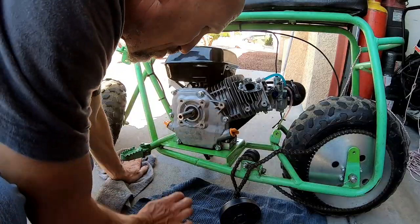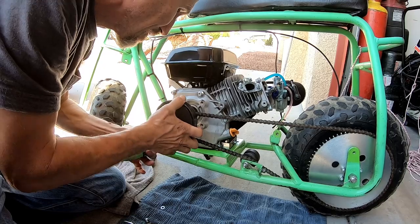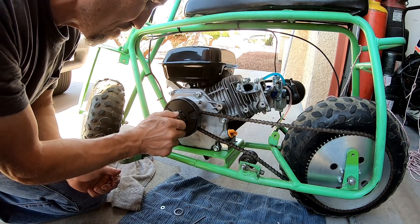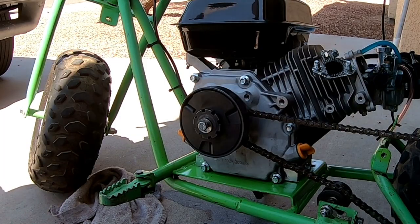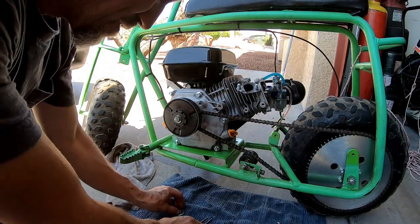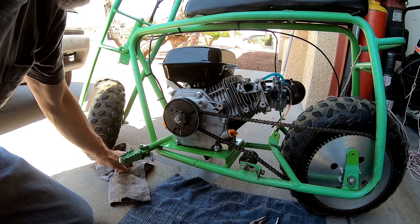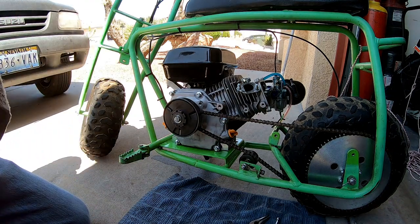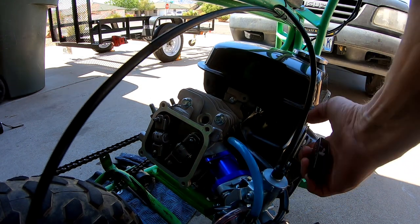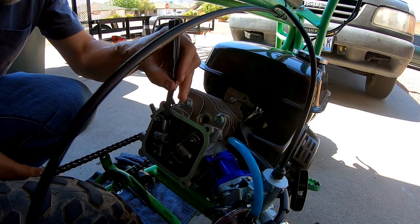While I'm down here I might as well pop the clutch back on. I'll put the bolt back in. Now let's go ahead and install these push rods and set the lash and we should be good to go. I will put oil in it too — that'd probably help. We'll set the valve lash at three thousandths.